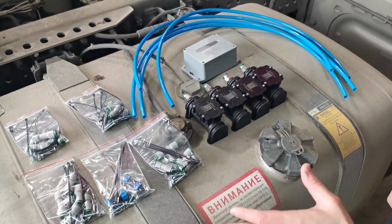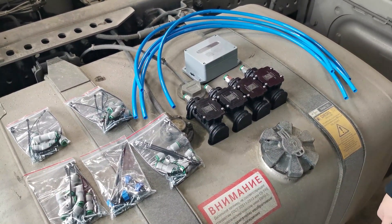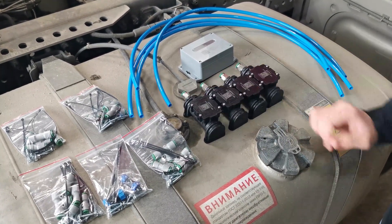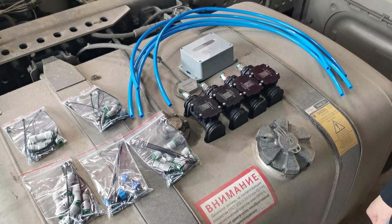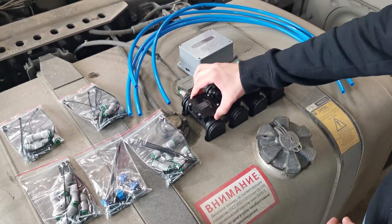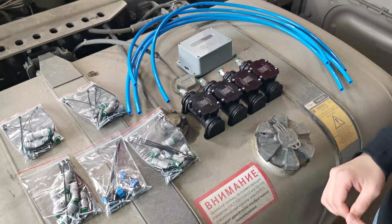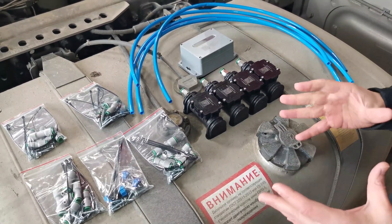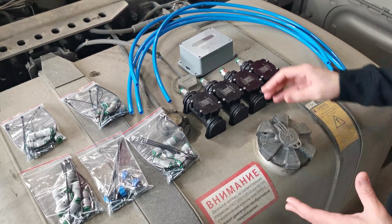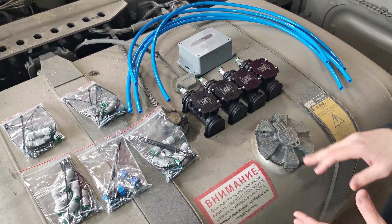So if you have two bellows located on the same axis, you have to use one sensor. If you have even four bellows but they are all interconnected, you also have to use just one sensor. If you have multiple air suspension parts on different axes, then you have to use as many sensors as actually needed.